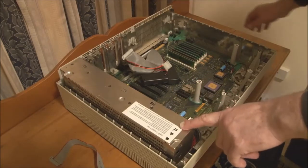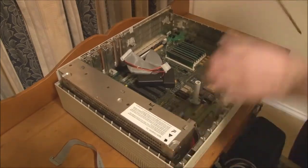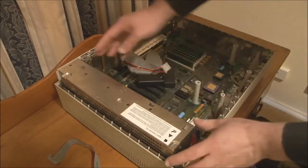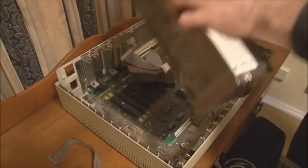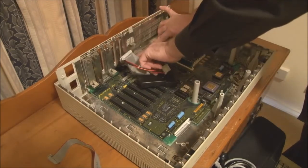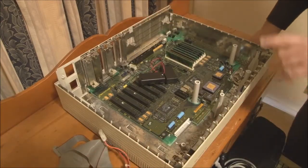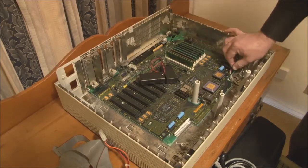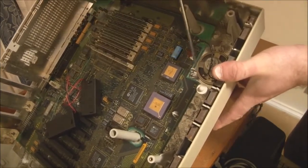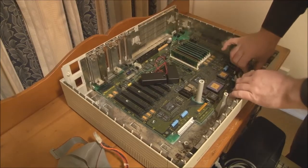What we'll now do is take out the power supply. We have one screw to remove down here. We'll take that out, make sure to unplug the power connector — just pull on it gently — then we can slide the power supply forwards and lift it straight out. There is the power supply out of the case. We'll also take out the data and power cables for the hard disk to give us a bit more room. Next we'll take out the speaker — unplug it, and there are two clips. Very carefully pull back on those while lifting the speaker up, and the speaker is now free.